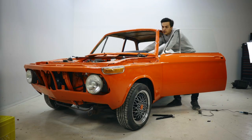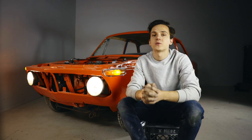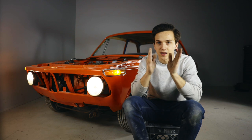Moment of truth — running lights, low beams, high beams — oh yeah! That's all we're going to be doing on the car for tonight. This was a really good step towards getting the car all wired up. Every night I'm just going to pick one circuit, learn it on a wiring diagram, and then wire it into the car. It's really important not to get too overwhelmed — just look at it as individual circuits. Pick one circuit, learn it, wire it, and after a couple of evenings you'll have the car all wired up. A few last things: solder as many connections as you possibly can — soldering is way more reliable than crimping. Where you do need to crimp, use high quality connectors and crimp them nice and clean and tight. Use rubber grommets when going through any metal holes. Use relays on any heavy circuits like cooling fans and fuel pumps. Stay focused, don't get overwhelmed, and we'll see you next Thursday.